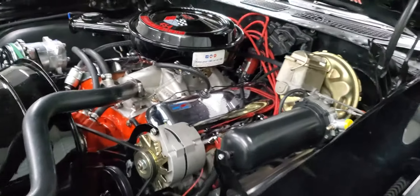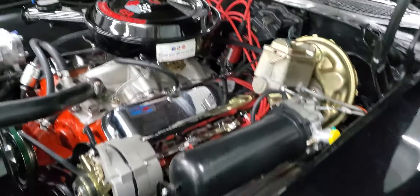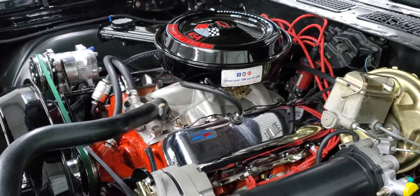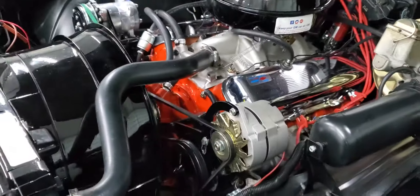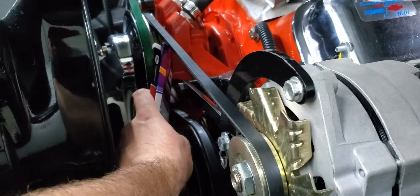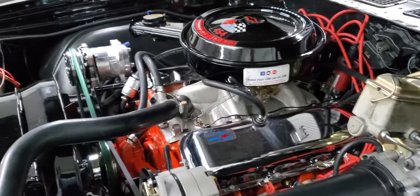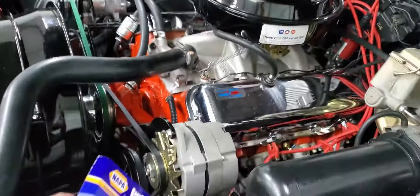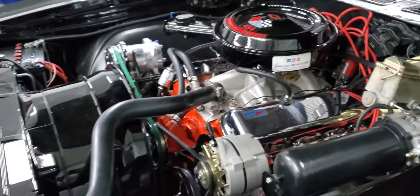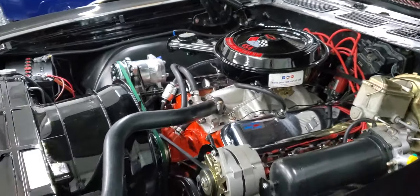I've got to get my new hood insulation on here — the belts flew off and tore it up. I hope this is helpful to someone. This is a great improvement and a final permanent fix to the belt length issues I had. I basically went back to the drawing board. I also went back to a chrome pulley that has a drop-down — the alternator place has a drop-down pulley unlike the stock pulley, just like the one that blew up into my face on the way to Pennsylvania. It allowed the belt just a little bit extra length and it worked out perfect. Thanks for watching — part numbers, hope that helps, see you next time.